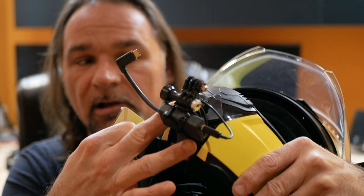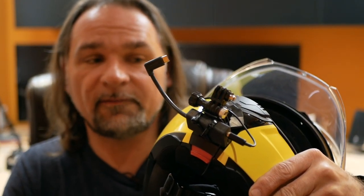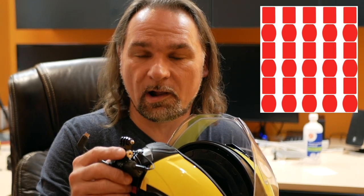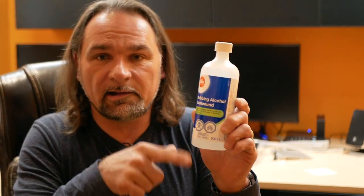The microphone adapter is held with two crisscross zip ties and it's solid — not moving left or right. For the final mounting of the GoPro to the helmet, I cleaned the surface and sanded off the bracket itself with very fine sandpaper. I used two 3M GoPro mounts stacked on top of each other, which gives a little more thickness and cushion — it absorbs more vibration so the camera won't vibrate while riding. After sanding, I cleaned the surfaces with rubbing alcohol, made sure everything was dry, then pressed it firmly for about two minutes in a warm environment.